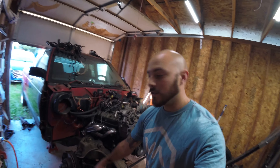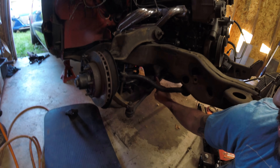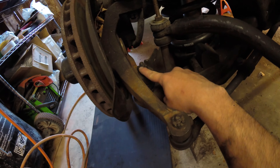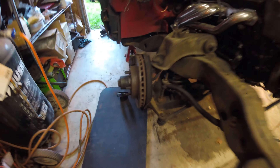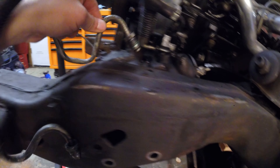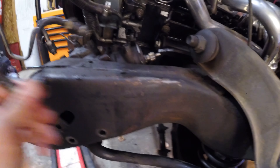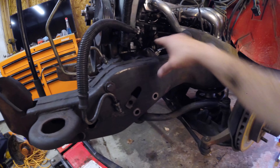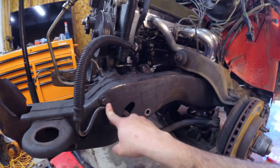Alright, got these suckers torqued on — I went ahead and finished torquing both the bolts on both sides, that way it's good to go. Everything's good, just need new cotter pins for everything. There's that one, that's an old one, I'm going to pull that out — it's just there to secure it right now. So just got to get new cotter pins for it and then that's good to go. I found some power steering issue — this thing here wants to rotate. I'm just going to look at that real quick, see if I could swap lines, because this line doesn't want to fit into that fitting. The high pressure is fine. I can get that to thread hopefully and get it to bend correctly how I need to without any kinks. I still need the two bolts here for the power steering to actually bolt that to the frame because it's not completely bolted right now.